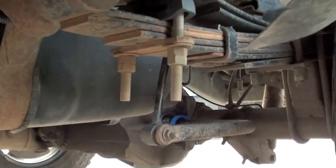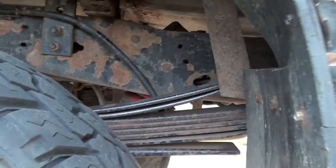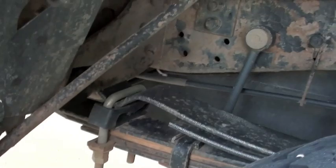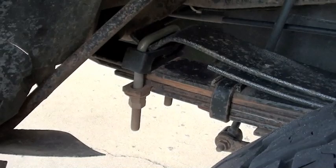I've still got my heavy-duty OEM springs — I love these things. The six-leaf is so much stronger than the old crappy five-pack I had when I first got the truck. It's night and day difference for that extra leaf spring, I'm serious. And then I've got the added Hellwig Pro Series helper springs on top, with little rubber dampers that prevent rattling or creaking — kind of like a flex bushing. These Hellwigs help a great deal with preventing trailer squat. I much prefer helper springs over airbags, but that's just me.